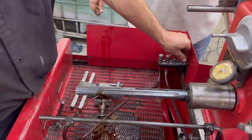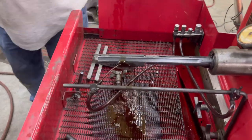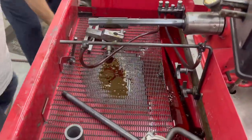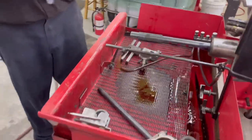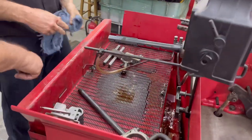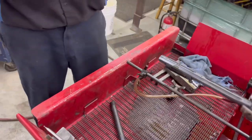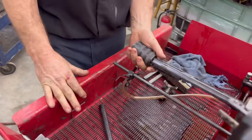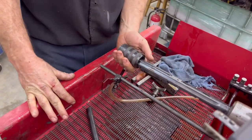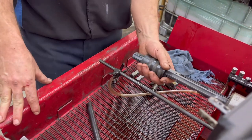Wonderful. So we're going to true it a little bit with that truing sleeve now. Remember what I told you. Put the motor off. That's a messy machine. You're going to put the truing sleeve on here. Foot pedal down until you just feel tension. No, you don't want the foot pedal on until you get it on there. Because it's free. Stepping on it tightens it.